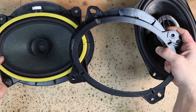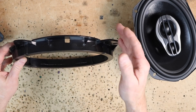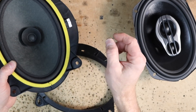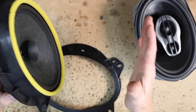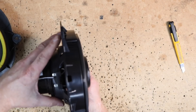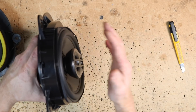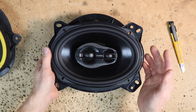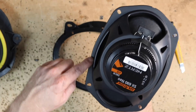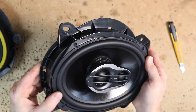Looking at the Metra adapter bracket, it's universal — designed to work in more than one Toyota. Check the hole pattern and note the lip at the top that covers the same opening area as the factory bracket. We recommend putting foam on the back of the bracket even if you're doing sound treatment, so it doesn't rattle. The factory uses a bead of foam on the back and foam on the front — we'll accomplish the front foam using our Fast Ring, which couples the speaker to the door panel and focuses the sound energy out through the door rather than letting it scatter everywhere. Also add foam on the back side of the speaker itself to prevent rattling against the plastic and to keep out water.